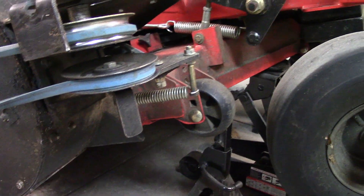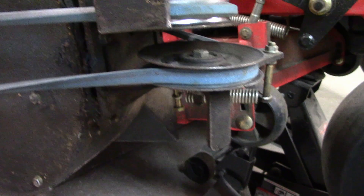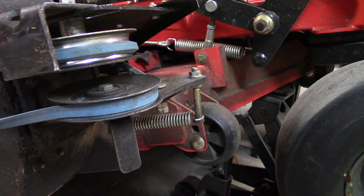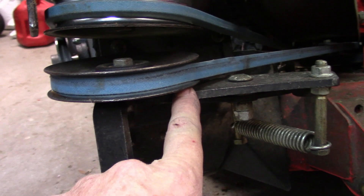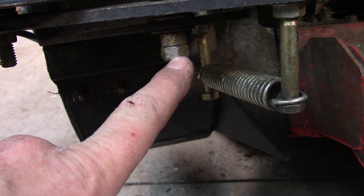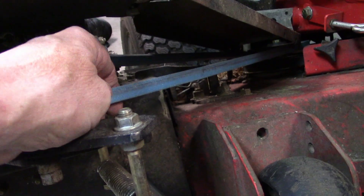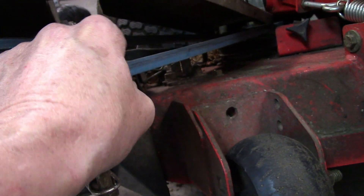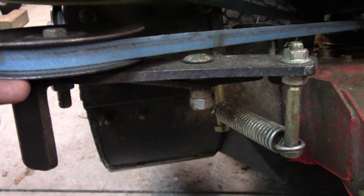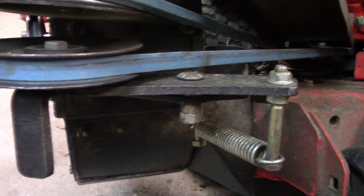Okay, I got the front end of the mower up, supported by jack stands, because I might be wrenching around on this and don't want it to fall off. This is what I was talking about — you can see looking at the side that this pulley is just kicked off to the front. I'm going to try a couple of different things, but more likely I will be bending this bracket. Right now I have two washers in there, and I had two springs on here, but I took one spring off and the belt's not as hot anymore, so that's helping quite a bit. It's not a real good design — it works, but it's not as perfect as it should be.